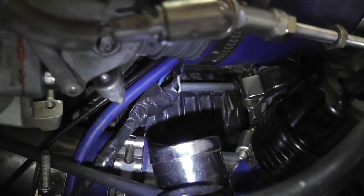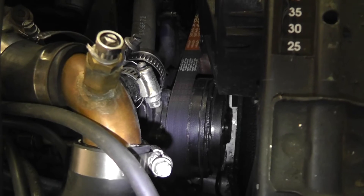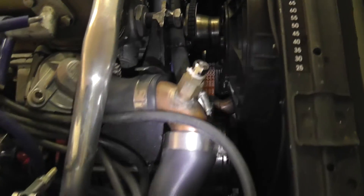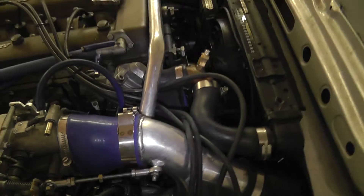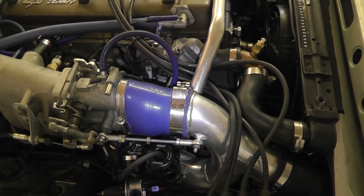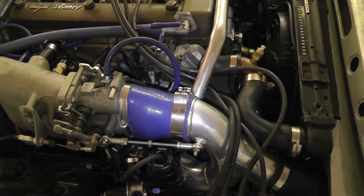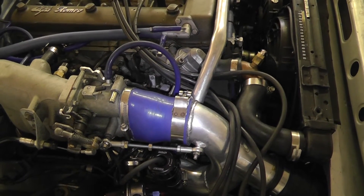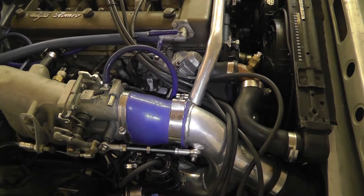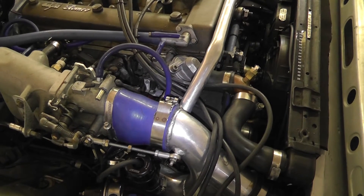There's an SC14 supercharger off of a Toyota Crown from the Japanese market. It is clutched and that clutch can be engaged and disengaged with the computer. Currently the engine is running with it permanently engaged, and the disadvantage is this supercharger is really only good for 150 kilowatts at the wheels and maybe around 15 psi. At that boost level it's making nasty amounts of heat and I don't have space for a second intercooler.